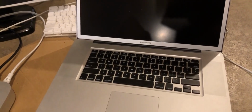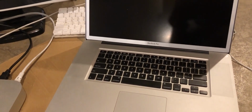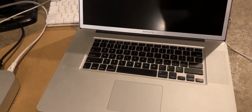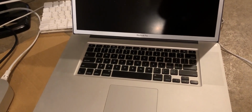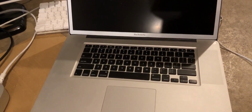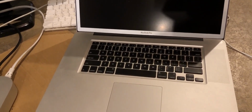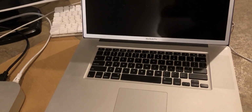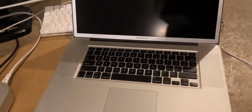And the main caveat is that of any 2009 or later system excluding the Mac Pro. On those systems, because the system firmware is so locked down, you cannot dump and flash the SPI-ROM from within the OS. So unfortunately, an external EEPROM programmer is required to do so. Now I'm not going to go into too much detail about that in this video, but I will show you the basic steps. So I just want to make you aware of that. So you're kind of on your own. You can use any programmer that you like that supports doing stuff like this. You can use a TL866, which is what I use, a CH341A, and even a Raspberry Pi if you choose to do so. There are methods for all of them. But for this video, I'm not really going to go into detail on that.